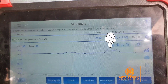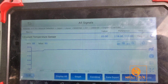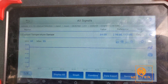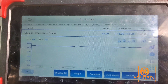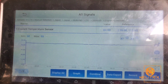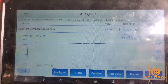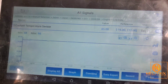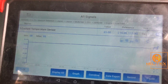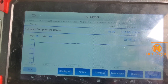Right here we can see the signal is very glitchy — it's jumping around between 70 and 90 degrees and it's not stable. Normally, coolant temperature cannot fluctuate like that; it will go up gradually or down gradually. So right away we can see there is a problem with that temperature sensor or its circuitry. To prove that, we are going to use a multimeter with a temperature sensor coupler and compare the signal from the engine temperature sensor to the reading from the multimeter, to prove whether the engine sensor is lying to the ECM.